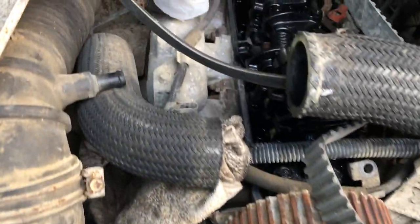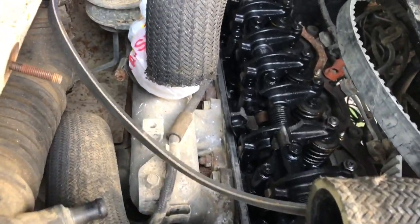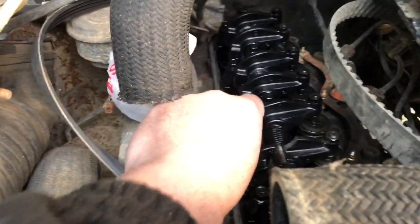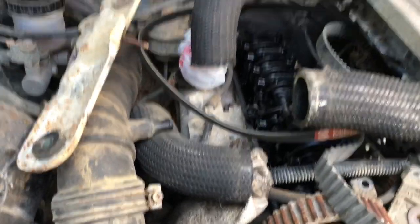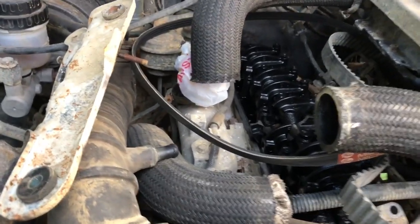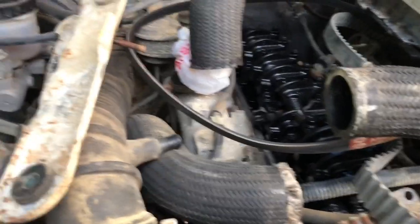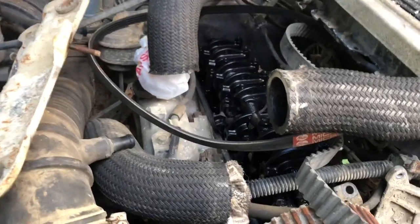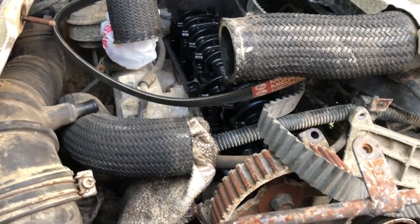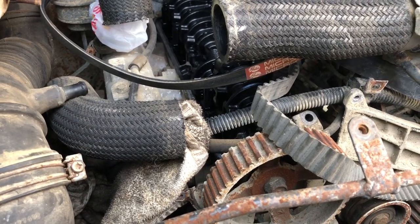I did take it to a garage — most of it's been disassembled, they've had a look at it, and it was deemed not worth taking the risk to just put a cam belt on and change the rockers. You can see the rockers here — some of them are snapped. What I want to attempt to do is, because I know it is an interference engine, logically you can see they snapped at the top. But sometimes people have been lucky enough to just change the rockers, put the timing belt in, time it in, and it might just start again.